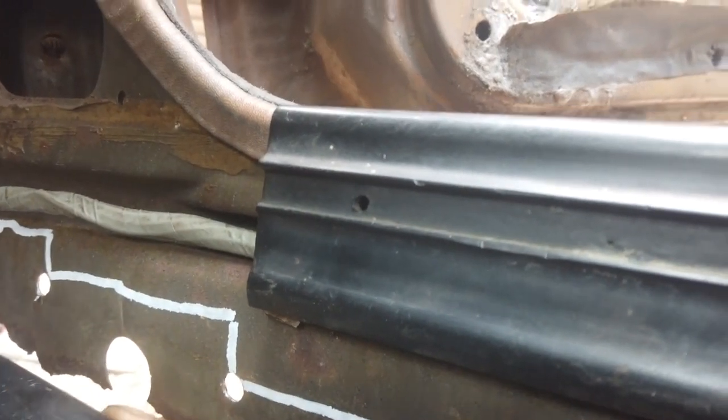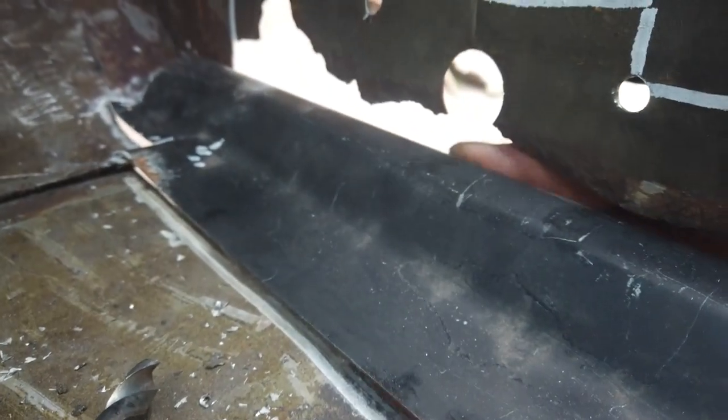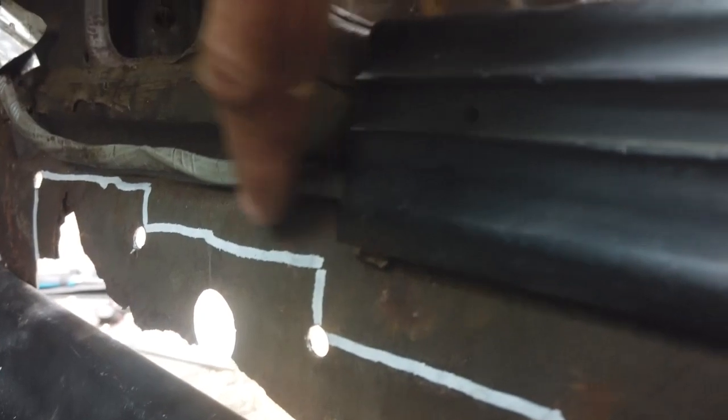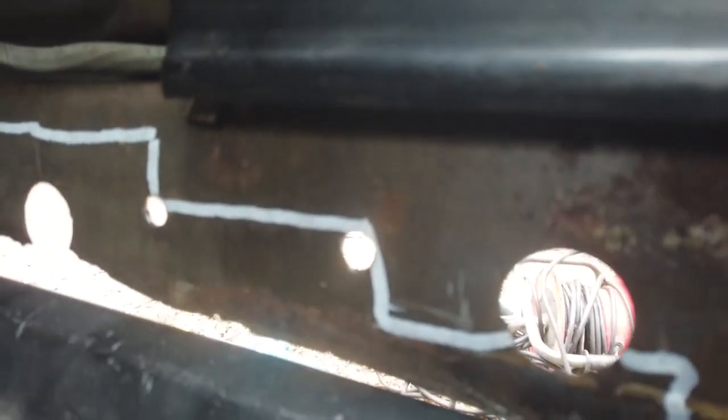The repair piece goes in here. It opened out a little bit there - that's my fault - but overall it's flush enough to get the butt clamps in. Those clamps basically space it out a mill and clamp it flush so you can get your welds in. Then the inner sill needs fixing. I've done this stagger cut because it gets progressively less rotten towards this end. I'm trying to preserve as much metal as I can - you could have just done one straight cut but it's actually easier to weld across, up, across, up.